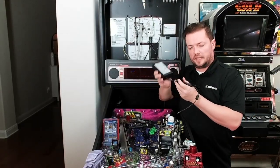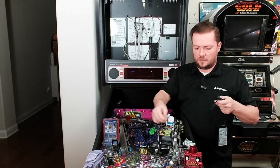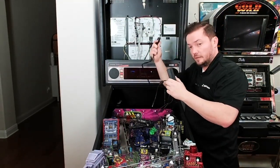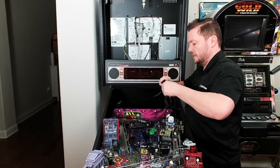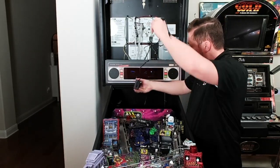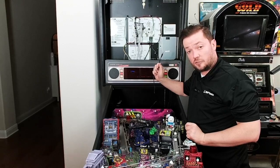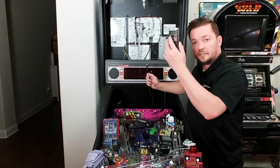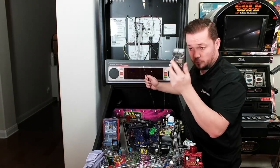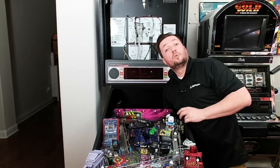With our play field down, take the 12-volt adapter, unhook the wire retention, and stretch it out. Using the cable we just dropped, plug it into the other end of the power brick — make sure to push it all the way in, as these tend to hang halfway out. Then just drop it down into the cabinet and let it rest there. This is what we'll plug into our Pin Lights control board. With the plastic protector already on it — which prevents shorts and protects the board — plug the barrel connector in and set it down in the cabinet.